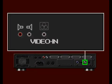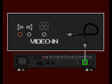To connect your CDTV player to a TV or VCR using the composite video — sometimes just referred to as Video Out or Video In — you will have to purchase a composite video cable from an electronics or video store. Connect one end of the composite video cable to the composite video port on the back of the CDTV player. Connect the other end to the Video In port on your VCR or TV. Since the composite video connection only sends video information, you will have to connect the audio ports to your stereo, VCR, or TV. Refer to the audio ports section of the interactive tutorial for more information on connecting the audio.